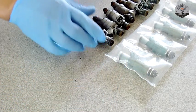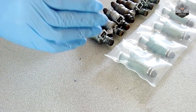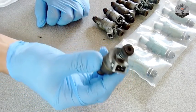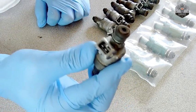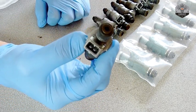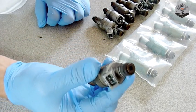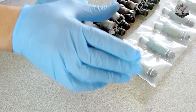These are the stock ones. I researched the options and found you pretty much have three choices. Option one: replace the original ones, or do a semi-upgrade and get a better injector. Option two: send them in and have them refurbished. Not just anyone does this job — one of the best companies I found is Fuel Injector Connection. They'll take your injector, clean it out, change the o-rings, and do the whole shebang.